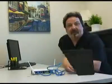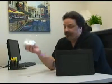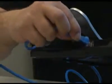You can see here there are just a couple of prongs and we plug this into the outlet — very simple. Then at the other end upstairs where you're going to put your picture frame, all you need to do is have your power line adapter connected to a wall outlet, connect the ethernet cable into the bottom of the opposite adapter, and then connect your ethernet cable into whatever device you're going to connect. All these are doing is using the existing power lines in your walls as an ethernet cable. The hardware setup is very, very simple.